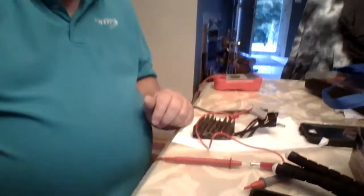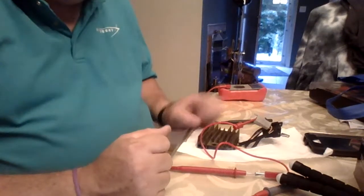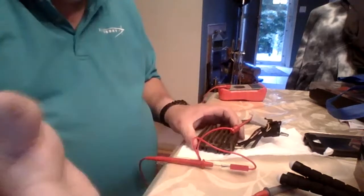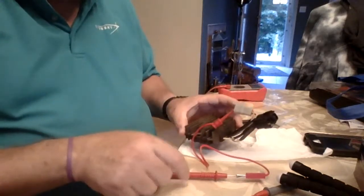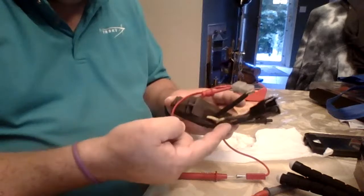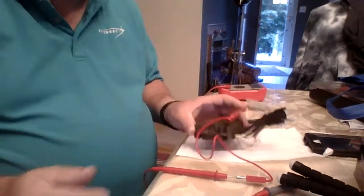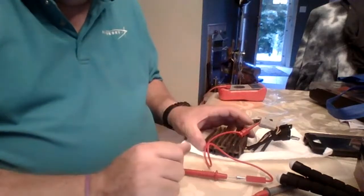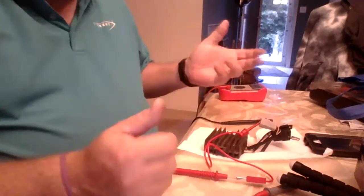I'll start with the old one. This is the one I took off of the Scag — all burnt up. You can see the burnt ends on it. Another thing: the difference with this one is it's shaped a little different, but also you'll notice the bulges in the stator leads coming out. Those bulges are diodes. Sometimes the diodes will be cast into the rectifier regulator, but in this case the diodes are actually in the stator line, so if they go bad you can actually replace them.